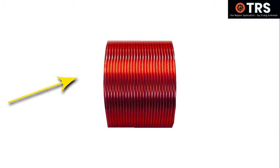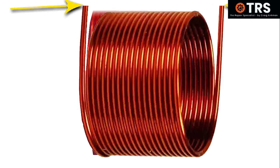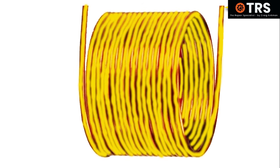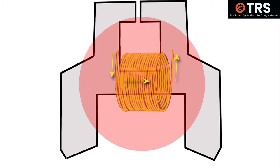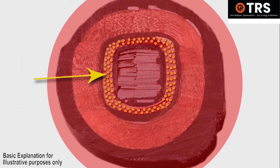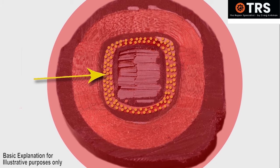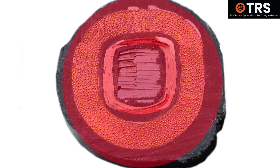The primary coil is just one length of wire coiled round, purposely made of the right thickness and length to allow the right amount of current through in a certain amount of time. From a cross-sectional view, we can see the current moving through the primary coil around the iron core, which creates that vital electromagnetic field. This electromagnetic field is designed to be present just for the split second when the fixed magnet on the flywheel passes the coil, and then when the magnet has passed by, it collapses. It does this every time the magnet passes the coil — creates the magnetic field, and then collapses.